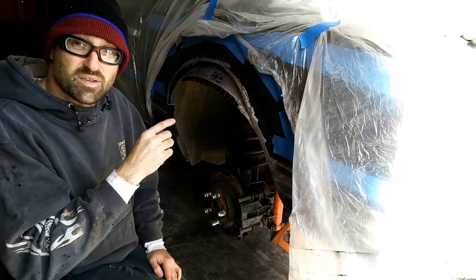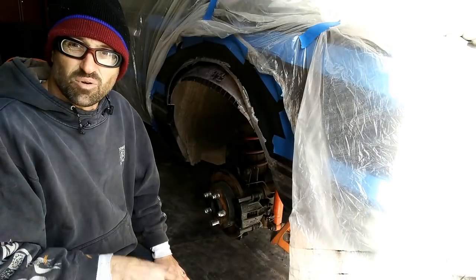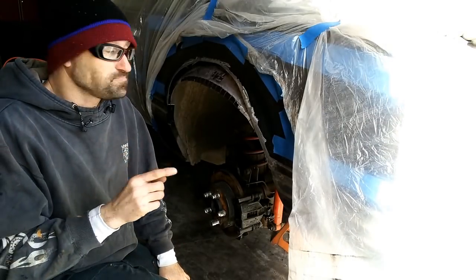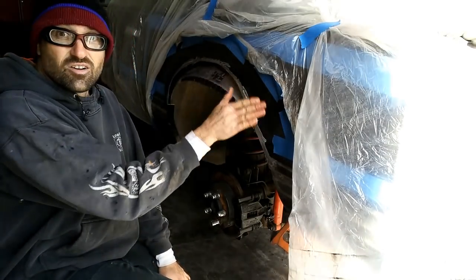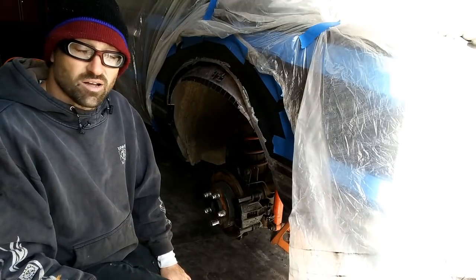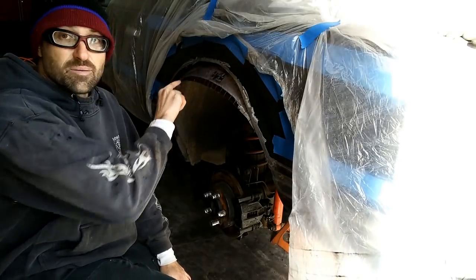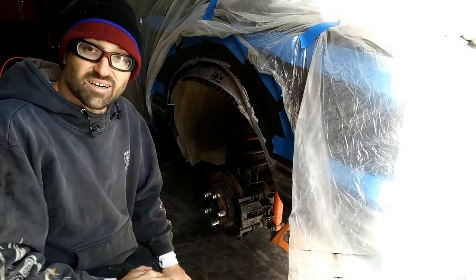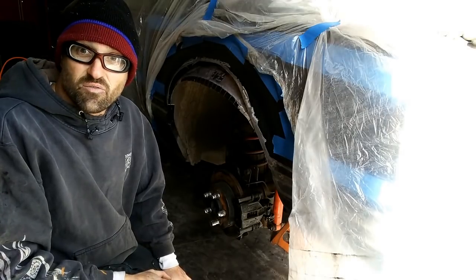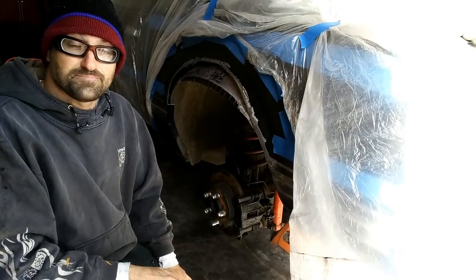This one I'm going to do that, because after you pie cut and start bending and all that stuff, it really makes it hard to get your grinding wheel in there. So I've ground the surface here, which will get some zinc coating on before I weld. And then I've ground the inner down all the way up under the lip. Again, it'll get some zinc coating before I weld. And once it's cut and everything, I'll double check it, make sure it's clean there.